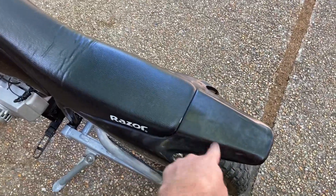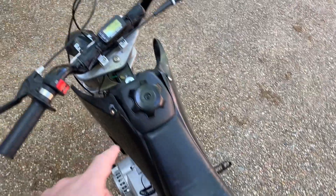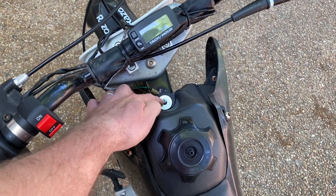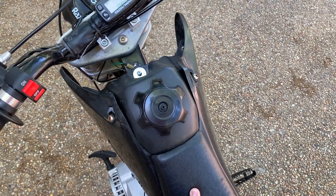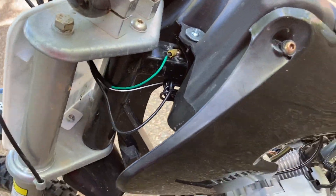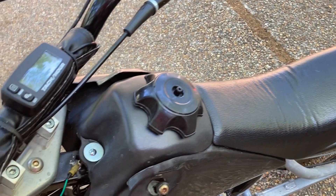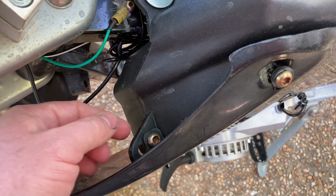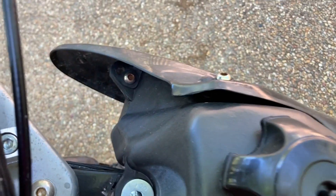Keep the seat and the fender bolted together, slide it up on the bike like it's supposed to be, then slide the gas tank in. You end up having to drill a hole just a little bit further back than the original, same for the one in the back. I drilled and tapped those, bolted it down, and drilled new holes here in the fender on both sides because there are nuts buried into the gas tank.